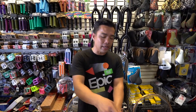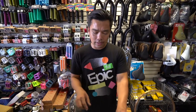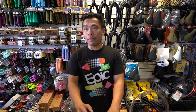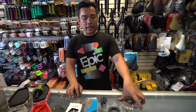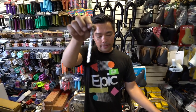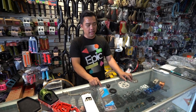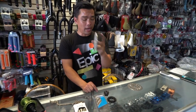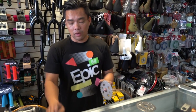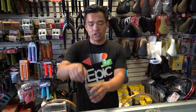Is there a strength difference between a 3/32" and a 1/8"? Not really — that's my opinion, not facts. One rule of thumb you guys have to keep in mind: a 3/32" chain on a 1/8" sprocket? No. But will a 1/8" chain fit on a 3/32" sprocket? Yes. Once you go one way, the wide one can fit on the narrow, but not the other way around.